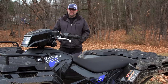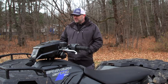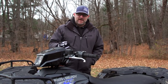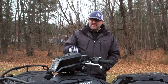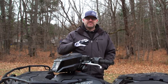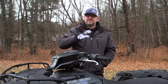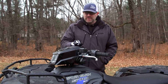I have ridden this — as you can see because it's muddy — and there are two things I want to gripe about. First and foremost: the power steering. Polaris has traditionally had some of the best single-mode power steering in the industry — speed-sensitive steering where the faster you go the less assist it gives you. Their systems have always been tuned spot on for pretty much any kind of riding. This one doesn't fit into that category. The assist is way too high for high-speed riding on a road or fire road — it makes the vehicle feel off-center, vague, and a little twitchy. Basically it doesn't ramp down the assist as speeds get higher enough, and I think that needs to be improved.